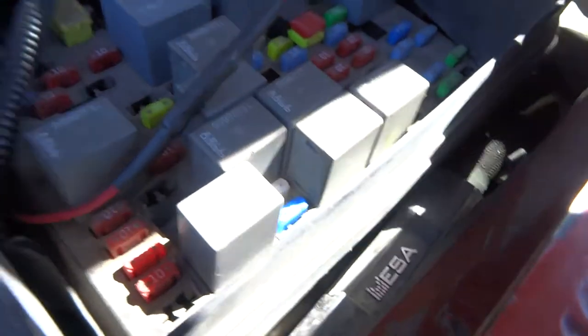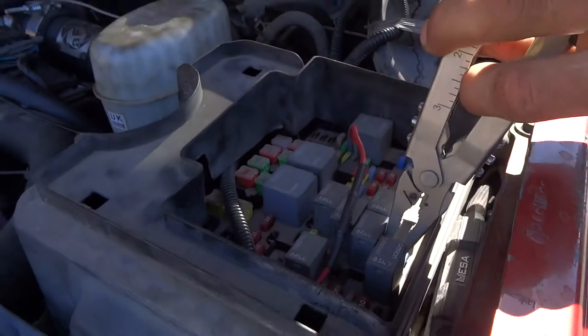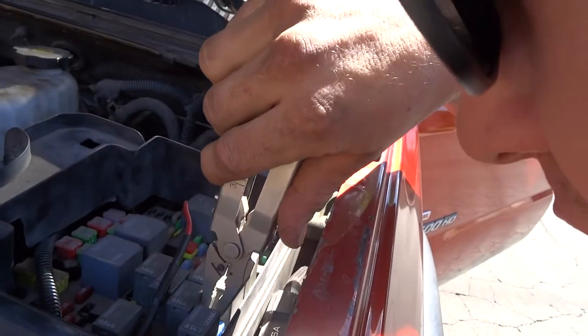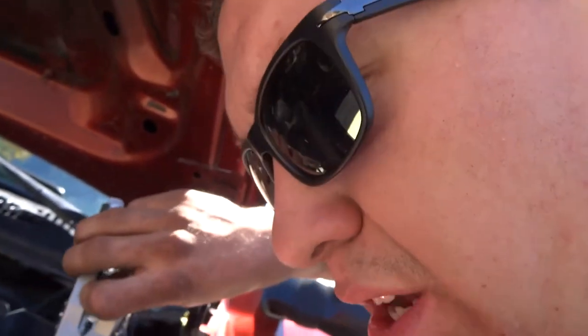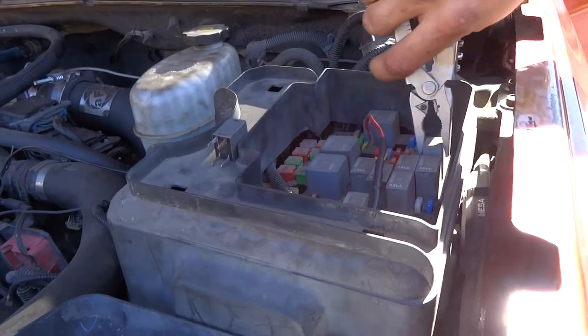I better just sort it out. There's probably a fuse — I'm going to look for fog lights right there. I even got too big of a fuse in there. It's fucking hot today boys. The fuse is still good. Why in the world would my light bar not be working? Unless this relay's bad. The best way to test relays in these trucks — just pull them out. Here's the windshield washer one — we'll swap that one in there. That's fine.